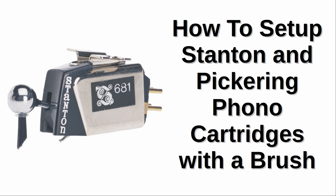I found out the hard way that you really shouldn't be playing vinyl, or rather polystyrene 45s, with the Ortofon 2M Blue. Ortofon. Still doing it, sorry. And that was because I noticed that it was causing some damage. Fortunately, I caught it before it did anything drastic or messed up a whole bunch of records. But yeah, I don't recommend that one for polystyrene 45s. You really need to have a conical or a mild elliptical to play back polystyrene.